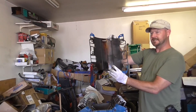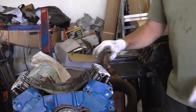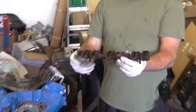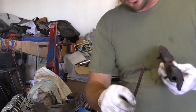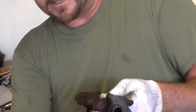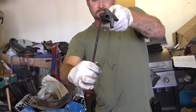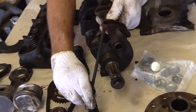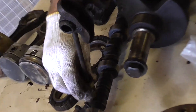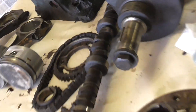This is the intake manifold gasket. Here are the rocker arms disassembled from the junkyard engine I just disassembled — they're really dirty but you can get the picture. Here's a push rod from the disassembled engine; the push rod goes right here and actuates, and the push rod is connected to the lifter. The lifter is actuated by the cam lobe — think of it disassembled: cam turns, pushes on the push rod and lifter, and actuates the rocker arm. That's how they work.